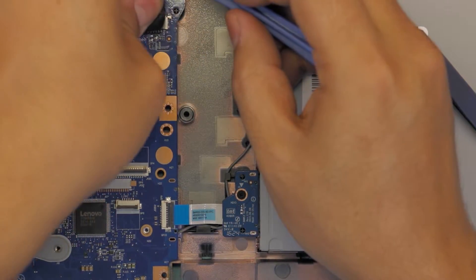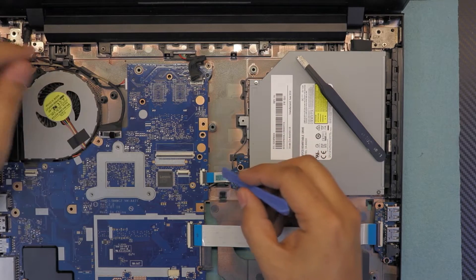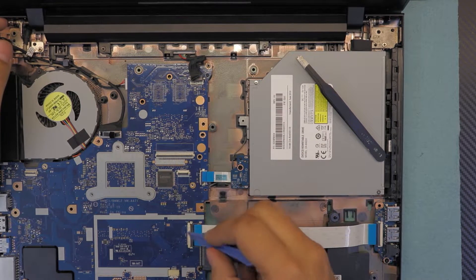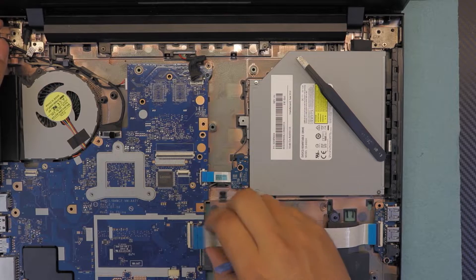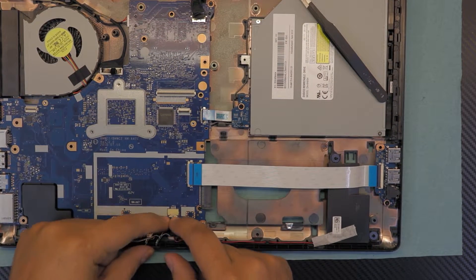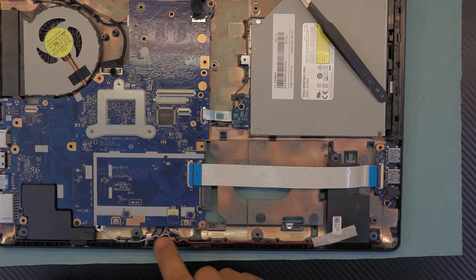So just go ahead and pull the jack out. Next, unhook the jack cable for the DVD drive. Unhook the cable for the extra USB that you have on this side for the audio jack. Unhook the speaker cables at the bottom. Don't yank the cable — just put your fingernails right on each side and pull the plastic thing out so you don't damage the cables.